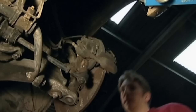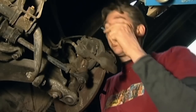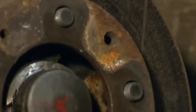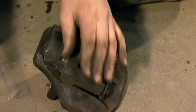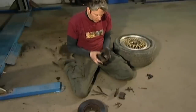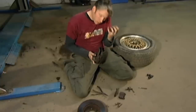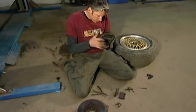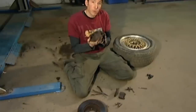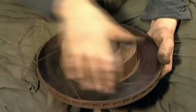More or less, any old car that has been standing will need attention to the brakes, but let's hope that the whole system isn't shot - that could be very expensive. I can get a reasonable view of the brakes from here, but I'm going to take them all apart so I can have a really good thorough look. I'll start with the caliper. Here's the front caliper off our Porsche, so I'm just going to take the pads out to get a better look. When I had to get this off the car, I had to wiggle it around a bit to push the piston back inside the caliper, and it was actually very sticky, which is not a good sign. There's quite a bit of corrosion around the outside of the piston, and the dust cover has really perished. For peace of mind, I'm just going to replace this with a reconditioned unit. The pads look fine, but they are cheap so we will replace them. The discs aren't pitted and are pretty good - rather than spend around £40 a corner, we'll keep using these.